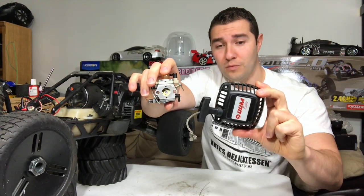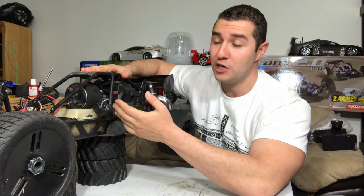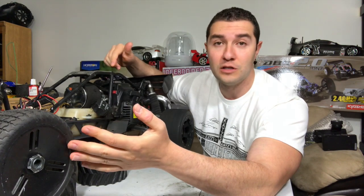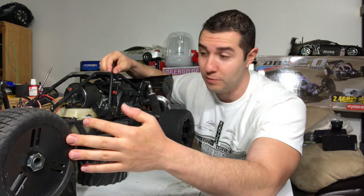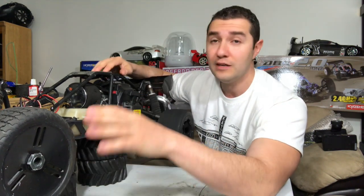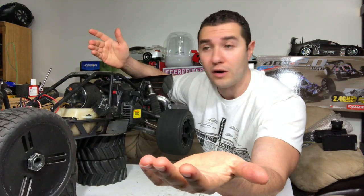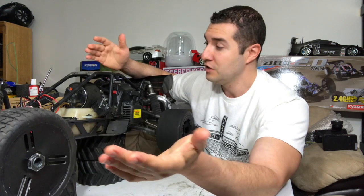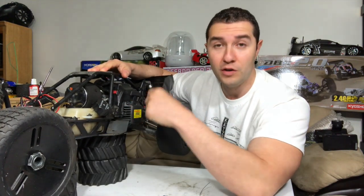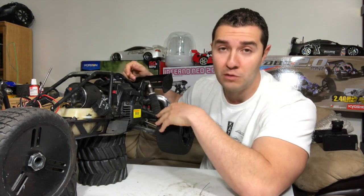Before all of this needed to be replaced, I went through the whole fit, scale, maintenance, and inspection testing techniques that I know. First, you want to check for spark. I tested the spark plug. Then I replaced the spark plug. You never know. In fact, you could have spark, see it visually, and the thing still won't start the car. But then I thought, okay, so it has spark, maybe it's not getting fuel. I even sprayed starting fluid into the carburetor under full throttle to see if it would start. Still nothing happened. At that point, I was pretty much baffled.